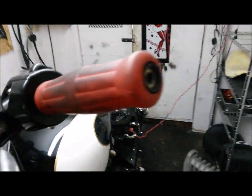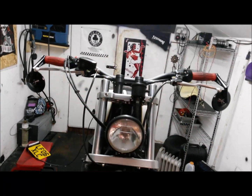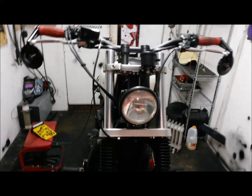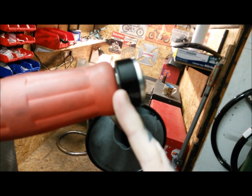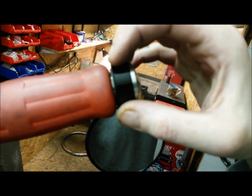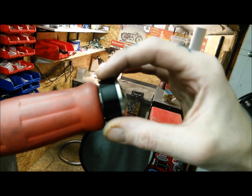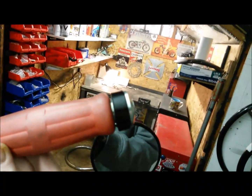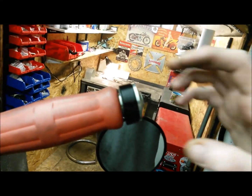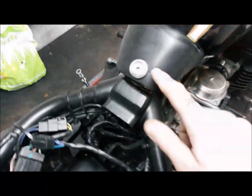Getting the bar-end mirror on - I've favored the underslung option, which I think is a little bit more stealthy than having them pop up. Rock hard, not going anywhere. The only thing I did was put a single washer in between the mount and the handlebar - it's a slightly smaller diameter than the actual bar itself, which pushes it away and stops the throttle from potentially snagging on there, since you've got a little bit of movement on the throttle. Just an extra precaution.